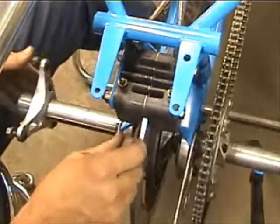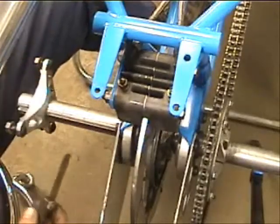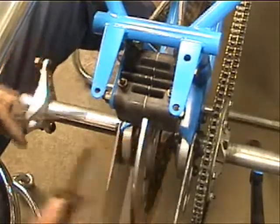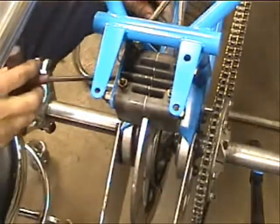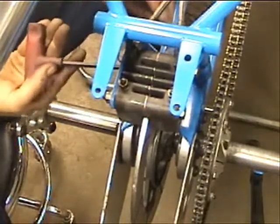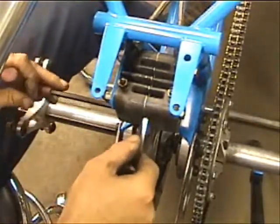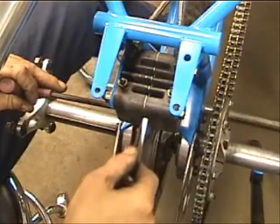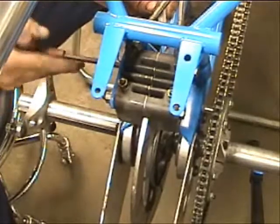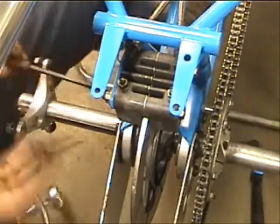You want to make sure you check it — roll it around and check it in a few spots. I like to adjust them one on each side, going front to back. Run that one in a little bit, come back over here, run that one until we got a little bit of a drag. We'll run that one until it's too much, then back it out. I got a nice drag on that one.